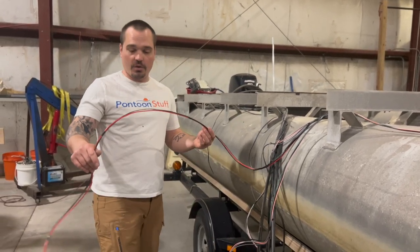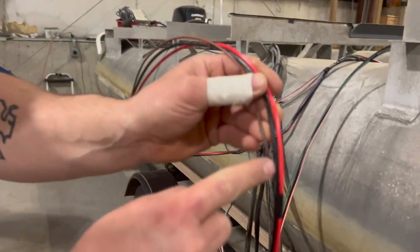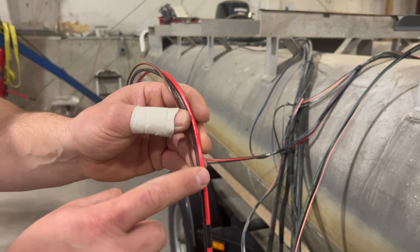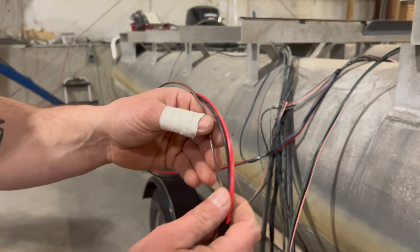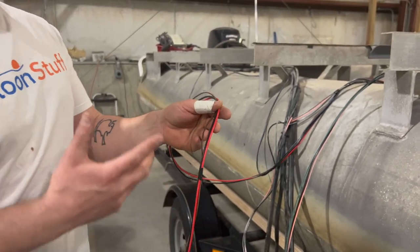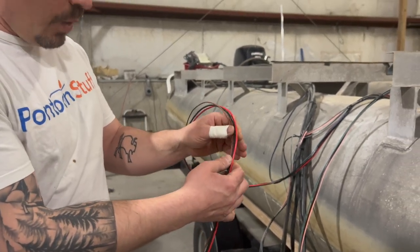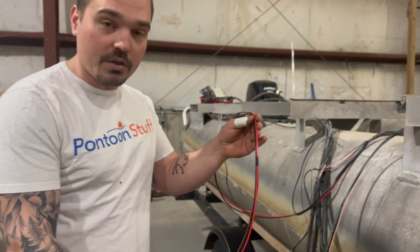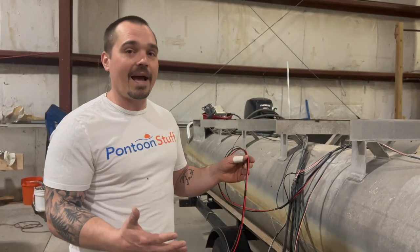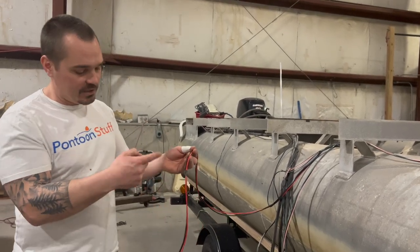The rest of the stuff going to the stern or back of the boat is a big 12-gauge ground wire that's black — that's eventually going to hook straight to the battery. We've got a big 12-gauge power wire that's red that's going to hook to the positive post on the battery. And then we have a brown with an orange stripe. This would be wired to a bilge pump, maybe a washdown pump, or any other accessories. It's a 16-gauge power wire and it will find a ground towards the back of the harness. It's really indicated by the color for a live well or live well pump, which would be on the back of your pontoon right down at the bottom on the bracket — that's why it goes to the back.